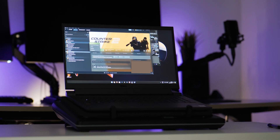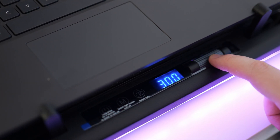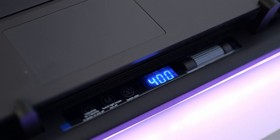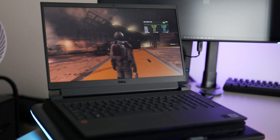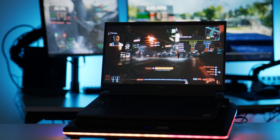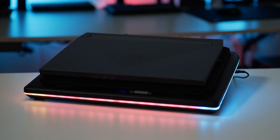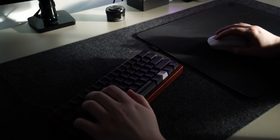To utilize the pad, just have it plugged in, put your laptop on top. You have an LCD readout of the current RPM of the fan alongside a quickly adjustable dial for complete control between 300 and 2800 RPM. Every time you move it, it adjusts immediately — no waiting. You also do not need any software because it's all hardware contained. Even at its slowest mode of just 300 RPM, it can still net you a decent temperature improvement with little to no added sound. I think most people will typically go between 700 RPM and about 1200 RPM, as that's where you get most of the temperature benefit without too much of an increase in overall noise.